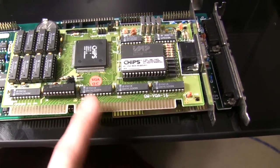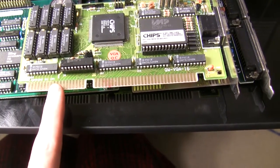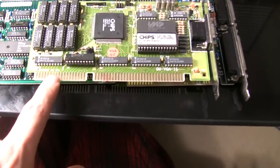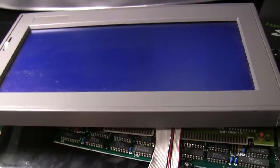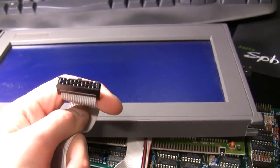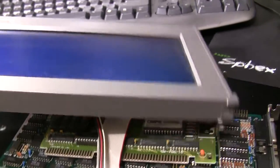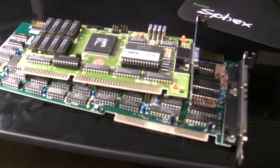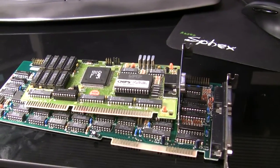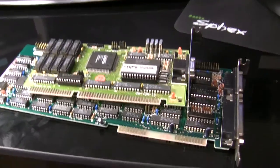Here's the sticky bit — this graphics card is just a VGA device, and I'm pretty sure this is not original to the computer. This is much more modern — 1991. My suspicion from before that the display isn't hooked up to anything is confirmed: this cable here wasn't connected to anything when I first opened the case. Someone's decided to just whack a VGA card in there and call it good, which has left this poor little screen completely unloved. I don't really know what I'm going to do about this — I suppose I'll have to find the original card, but good luck with that.